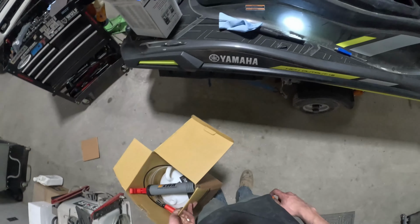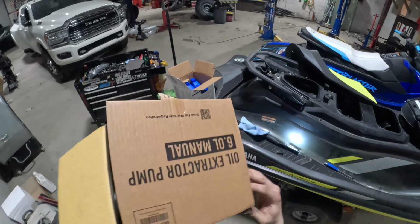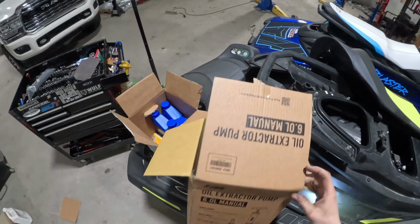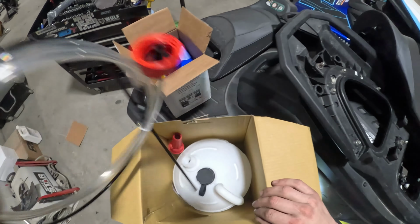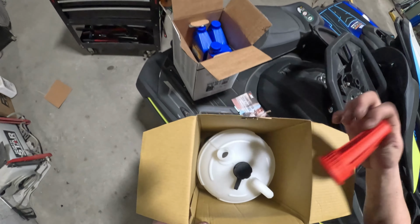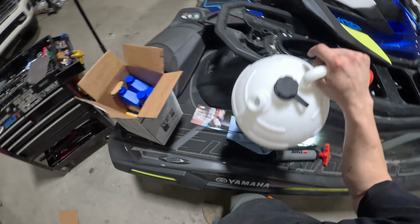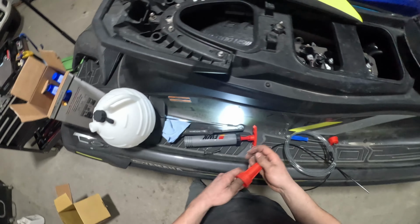So this pump right here is what we use and recommend using for the removal of the oil. I've got a link for this down in the description below. This is a vacuum extractor. So once you go ahead and start to pull a vacuum on the oil through that dipstick tube, it's gonna constantly drain there on its own. So there's not any pneumatic hookup, there's not any constant pumping or anything crazy like that. Once you pull that vacuum, it's gonna go ahead and drain all on its own.